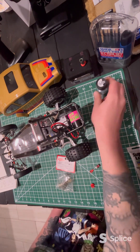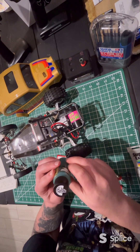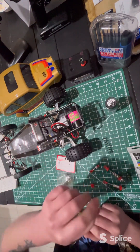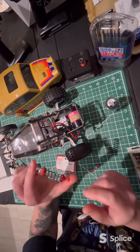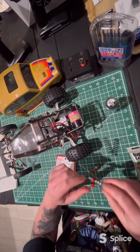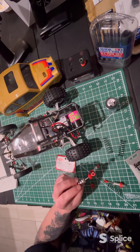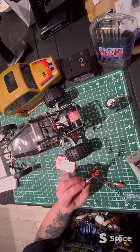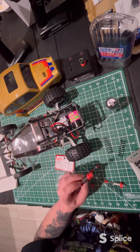Instead, what I ended up doing was thicker oil. I went with the Team Losi — this is a 70. Now, for a lot of you, you're going to say that's pretty thick oil. Well, it's a pretty heavy buggy, and unfortunately it's a very short stroke on these shocks, so I don't have a whole lot of room. But anyways, that worked like a charm. These shocks were actually leaking after only a couple runs. Maybe I didn't assemble them the best — it's been a while since I built shocks — so maybe I was a little rusty.